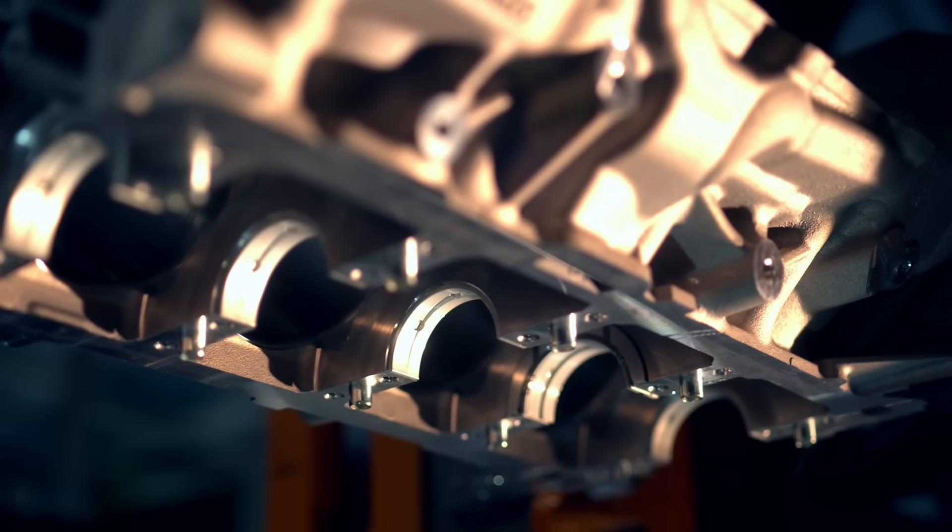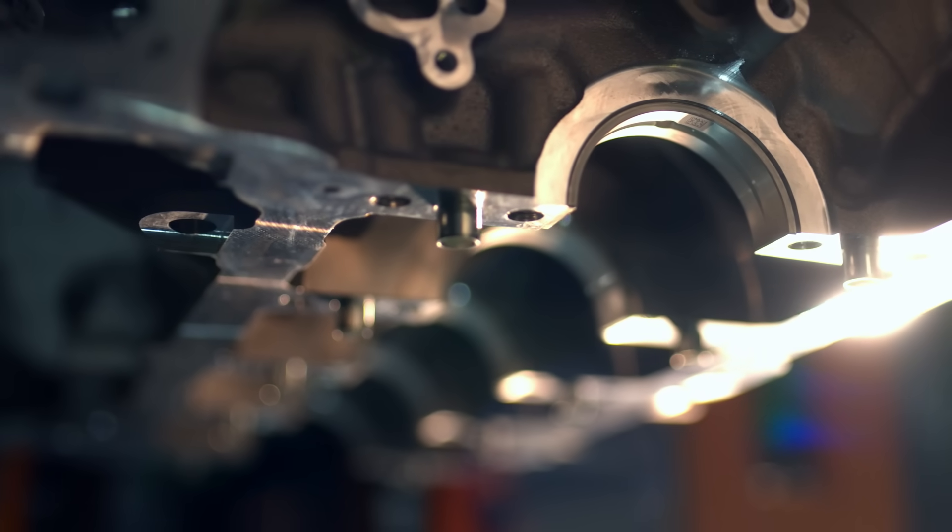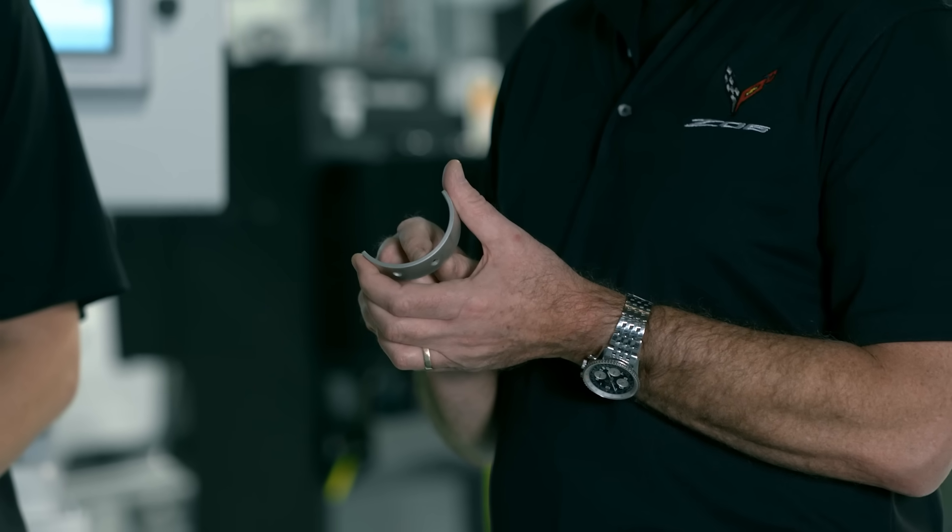There was an old saying: drive it like you stole it. Don't do that — that's a terrible thing to do. The biggest component you're protecting is the running surfaces, or the bearings. You need to give the bearings that first critical 500 miles. There's actually some material in the bearing that moves around — the top layer of the bearing is about 20 microns thick. Human hair is about 70 microns, so we're talking fractions of a human hair. Since the engine vibrates and goes through orbits and gyrations, that soft top layer on the bearing will actually move around and adapt.